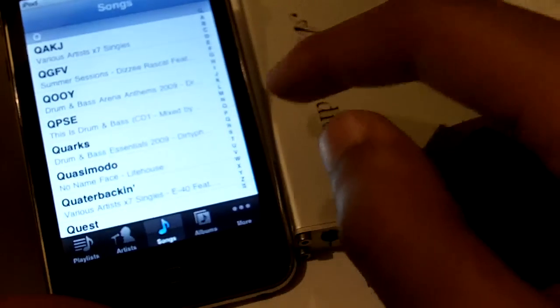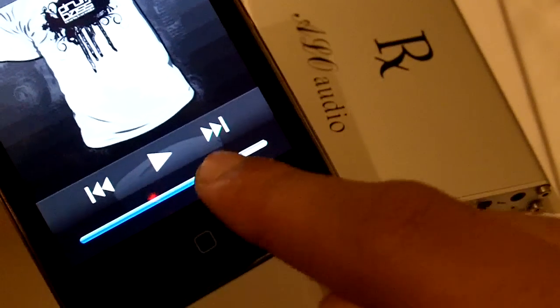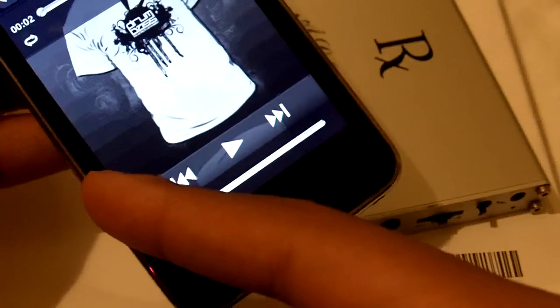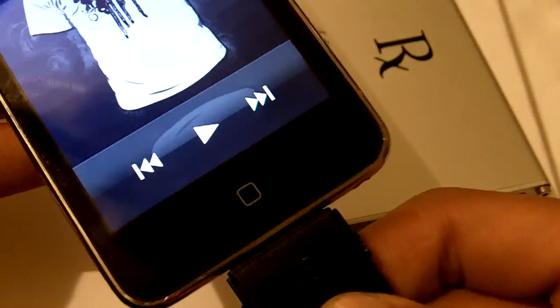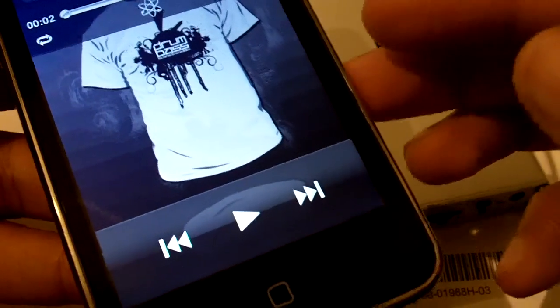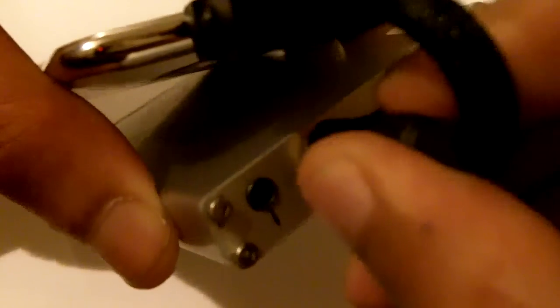Say I'm browsing through my music. As you can see, the volume control is active — I can control the volume because the amplifier in the iPod is active. I plug this in. The volume control is gone. What this did is deactivated the built-in amplifier in the iPod. So now all the digital-to-analog converter is doing is sending a signal through this cable. Then you plug it into the input and you're all set.